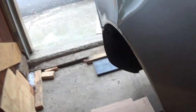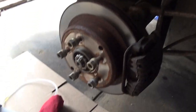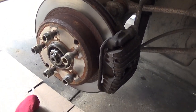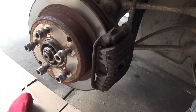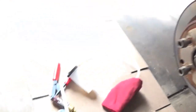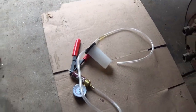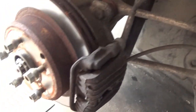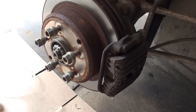So now we're going to start way back at the farthest point away, and that is the right rear caliper. We're going to try and get as much of this crud out of this line as possible. I'm going to be using a brake vacuum pump to pull the brake fluid through the line to here, and we'll see what we get.